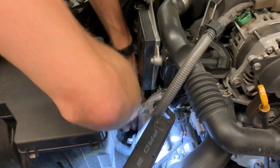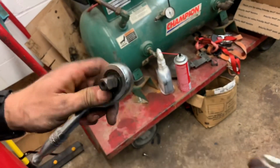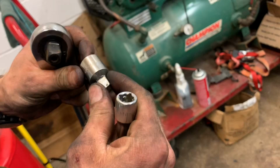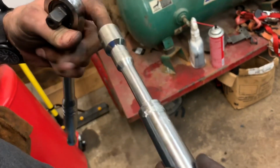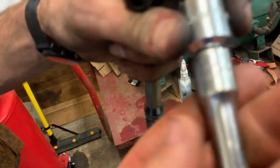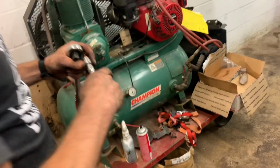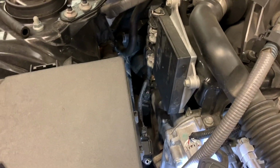So as Mike stated, what we have to use to get the spark plugs in all the way is... My good pal Weston over here came up with a brilliant idea to go from 1/2 inch down to 3/8. It buys you just enough space to get the ratchet out into the open. And then what is that, a 3-inch extension? It'll say on it. I'm going to assume it's 3/8, a 3-inch extension and then a deep well socket. And that is exactly how much room you need, or you need an assortment of extensions to get that out.